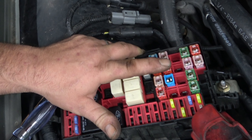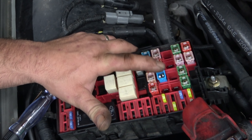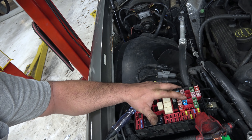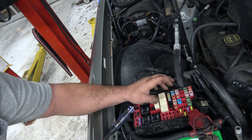So I did a little digging and found no fuse in the hole. Plugged in a fuse — got communication back. That fuse without a top is the one that was missing. I didn't have the right amperage, so I stuck a generic 20-amp in — it's supposed to be a 30-amp — just for testing purposes. Got communication back, but still no crank.